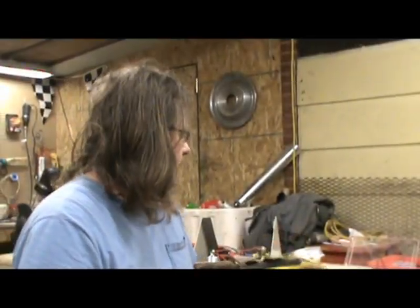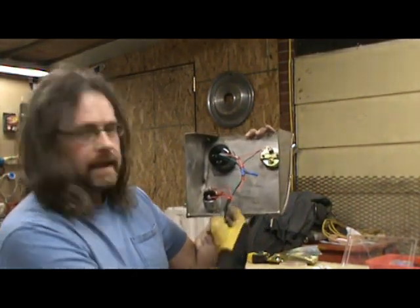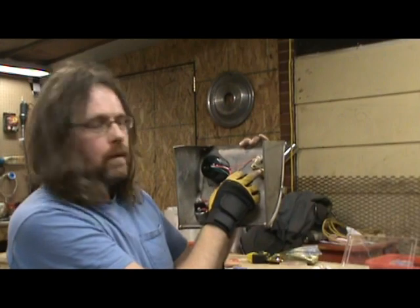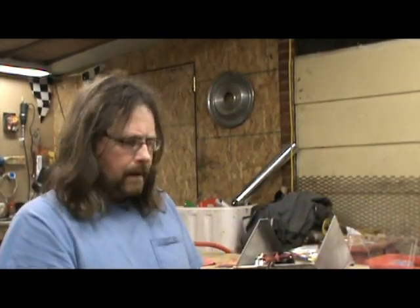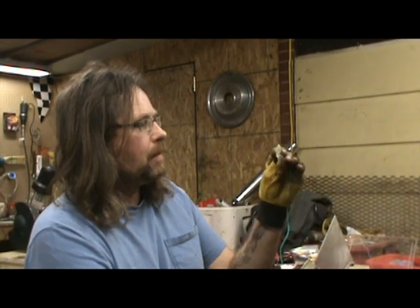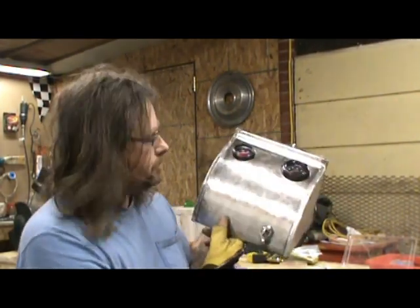All right tubers, I'm back. I've made a little progress. On the back of the console I made up all my connections, and put them in a little bit of tubing that came with the tach where these wires were supposed to group into — heat shrink would actually do a better job. I've got to get my oil line hooked up on here. I went ahead and labeled the wires since I didn't have a lot of different colors — battery positive, the starter that goes to my solenoid, the coil hot which is my tach wire that goes on the ground side of the coil, my ground, and so on. It's just going to make it easier when I go to hook everything up. I think it's looking pretty good. I'm getting there with it.